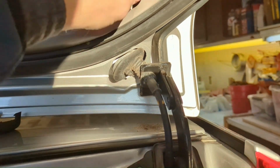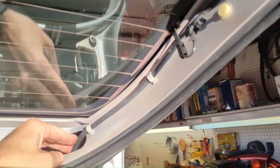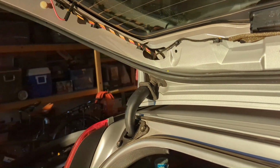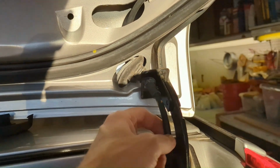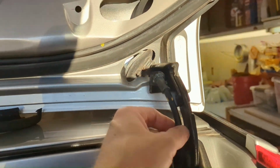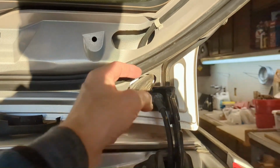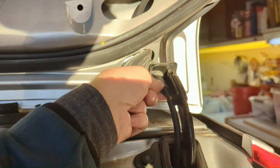Actually, no, it's not. That's actually, not coolant, window washer fluid. So all the wires are on that side. This is just a line for the rear washer fluid. It comes up through here, folds along, runs over, it goes right into the center bore on the wiper that is sticking through there on the shaft. So I'm not going to be able to run it through this grommet with it.